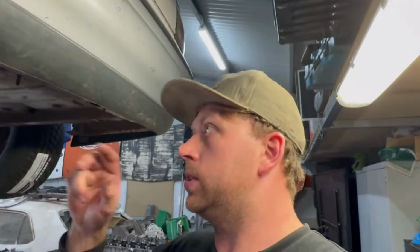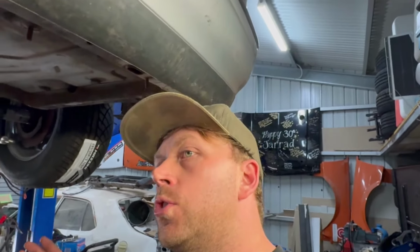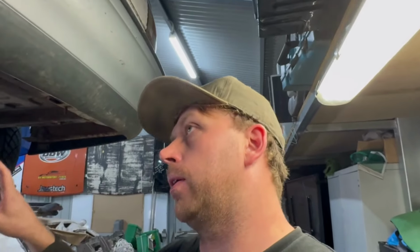So I'm going to get this all tacked in, stitch everything in place probably, so not quite a tack, not quite a weld, just stitch it all in. Because I have rethought what I'm doing here, and I'm going to do one final weld out right at the very end. So I'm going to fully stitch all these in, but not fully weld them in, if that makes sense. Reason behind that being is, after this stage, which will be putting the actual tubs in, putting the actual wheel wells in, I'm going to have to pull it all out again, and I don't really want to have to do it twice for no reason. So yeah, that's the method behind my madness of only welding it out at the end.